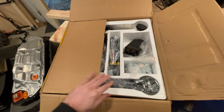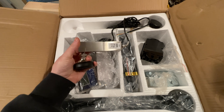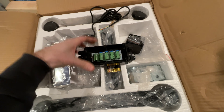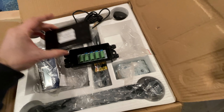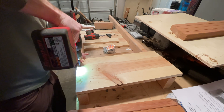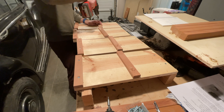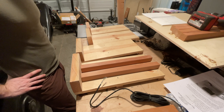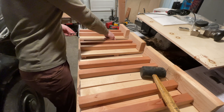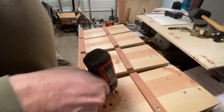I decided to do this leverage idea, but instead of using bathroom scales, I bought load cells. I just bought a DIY agriculture scale. This comes with four load cells and a readout panel. This was intended as a cheap way for people who want to weigh cows and goats to build a scale — just make some kind of platform, bolt one load cell at each corner and weigh your pigs. I figured I could scale down the balance scale thing, make four of them and have cheap compact corner weights. I built platforms that would rest on a two-by-four on one side and a load cell on the other side. I made the platforms kind of small, but big enough for a tire contact patch. The wheel would be centered using wood strips, offset towards the load cell. I can't put the load cell directly under the tire, otherwise it wouldn't have any stability. The load cell is offset a little bit, just like the balance beam thing we did earlier, so I will have to do some math. Thankfully I have a calculator that makes all that math I learned unnecessary. The idea was to put one of these under each tire and use the readout to switch between the load cells, writing down each one.